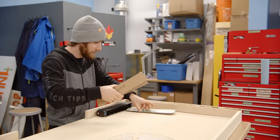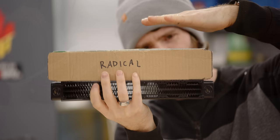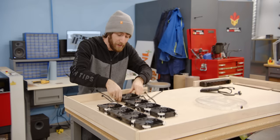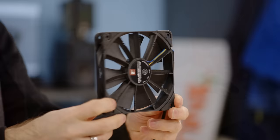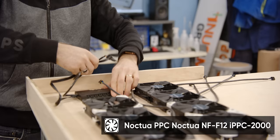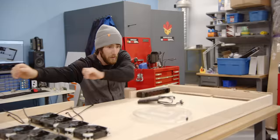We made a small oopsie and only ordered one of them as part of our proof of concept, so you'll have to imagine there are more over here. The only question is whether that's going to be enough radiator surface area — we think we'll have about the equivalent of a dual 120mm rad. The idea is massive positive pressure: we're going to have eight Noctua Industrial PPC fans with filters, basically creating a pressurized chamber in the case. That's going to cause air to passively whoosh over components that need air cooling, like the motherboard chipset and VRMs, and then exhaust through the only unsealed part of the table, which is going to be the radiators.